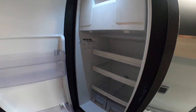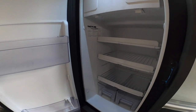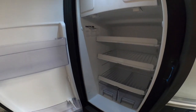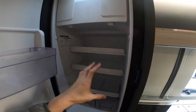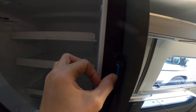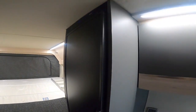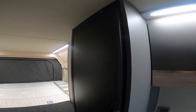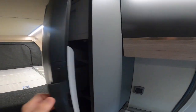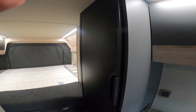It's a decent-sized fridge. When winterising the vehicle, it's very important that you look after the fridge as well. What you want to do is leave the door open ajar to stop clean air becoming mouldy, smelly air. There's a little blue clip — you pull it out slightly and just rest the door against it. You'll notice the door's not flush, it's just resting up so it allows air circulation at the top and bottom, so the fridge doesn't grow mould in there when you leave the door shut. Just rest it up and that will be good until you come to reuse the motorhome in the springtime.